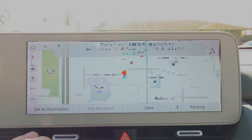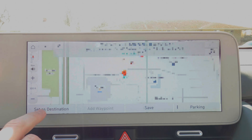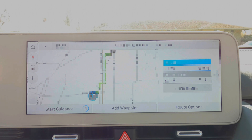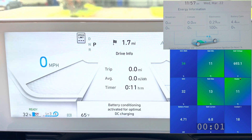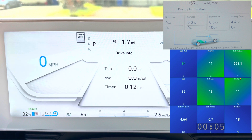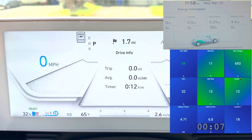I'm going to pick an Electrify America station. I'm not going to show you exactly where it's at, but we'll click set destination in the corner and it will calculate our route to that DC fast charger. About a minute later we can see the sign: 'battery conditioning for optimal DC charging,' which means it's now heating the battery.